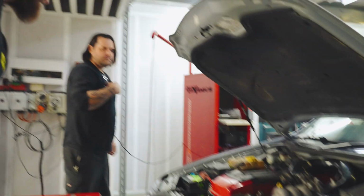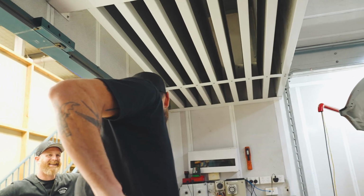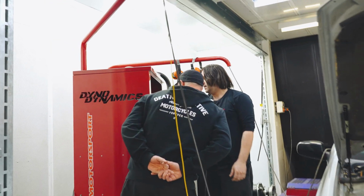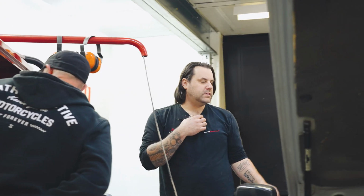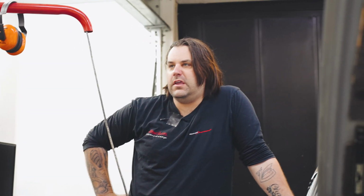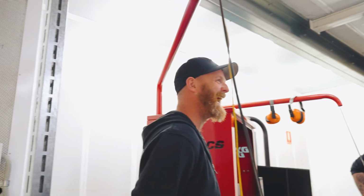313. Yeah, still smashing the 300, and that's the boost winding up, holding 17. So all conditions all day long. Bounce around there. My fueling is just flat, sitting nicely. That's the go. About 11.8 is what I want on a boosted car on 98. Perfect. And that's at the tailpipe, so it's slightly richer at the motor anyway. Enough to not be that smoky and do everything it needs to and be cool enough to just work every day.